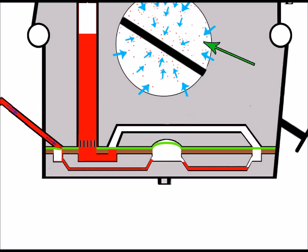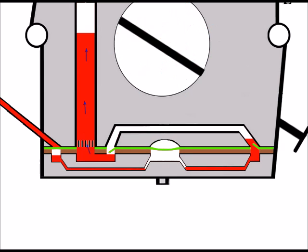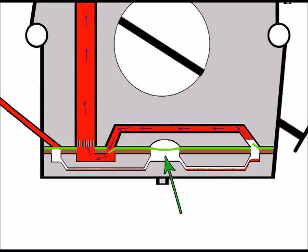So when the throttles open fully for high engine revs, this amount of fuel wouldn't support that amount of revs. And what we end up with is bog down. The engine stops. This kind of restrictive defect can happen on any of the valve flaps on the diaphragm, by the way. I only use the first one as an illustration, but there can be any.